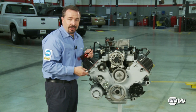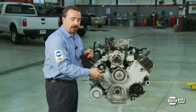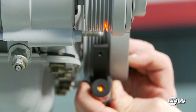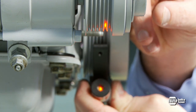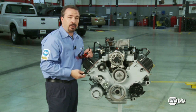Now that we've checked the power steering pulley and found it was out of alignment, we can go back to the crankshaft pulley and check the air conditioning pulley. Once we find that's okay, we can use it as a point of reference to check the other pulleys in the drive, such as the idler and the alternator itself. This will give us a complete diagnosis of the system.